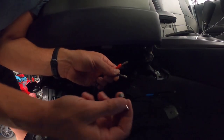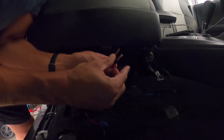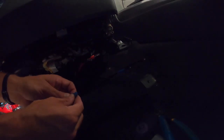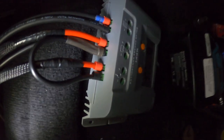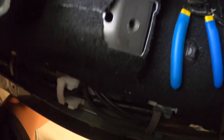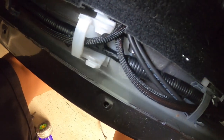All I did was strip the wire, twist it, and take my terminal, shove it in there, and twist it around. You can see they're both at the end, ready to go, and when I put the screw in from the MPPT controller they'll tighten down on the wires. I screwed in the ground wire, ran it all the way, so all my wires are right there bundled up — a jumper for the ground negative so two going into one. The wires go in under here into the channel, one going left all the way back for my accessory and one going right to the battery hookup.